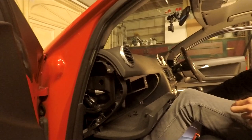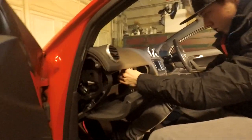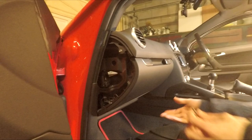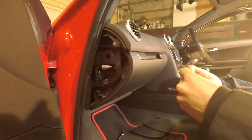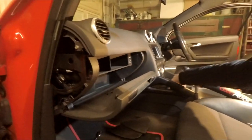Once you get one screw in the rest is pretty simple — just go around the glove box putting all the screws back in that you took out. Once you get all three of the top ones in, lift the glove box back up and get the ones underneath in. Make sure you're only using the silver bolts for the outside of the glove box, because the one inside at the back is actually painted black.